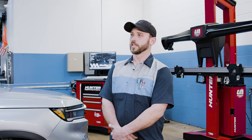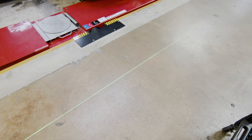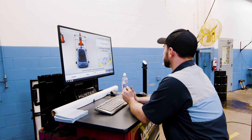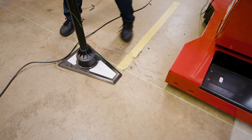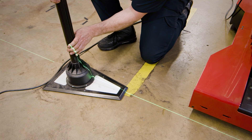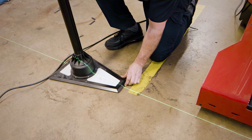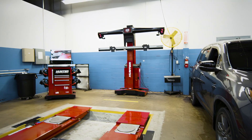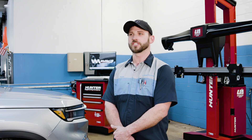When you use the ADAS system, the lasers on the ADAS machine not only give you clear space around you, they measure the floor height and space to make sure you have enough clearance. They give you the target placement — the line that the target needs to be in line with — and then a red dot exactly where the target needs to be set. All the targets have crosshairs showing exactly where the laser and dot need to be.